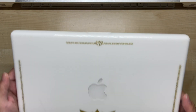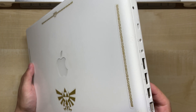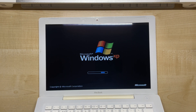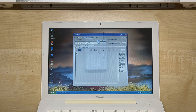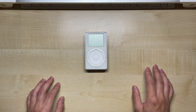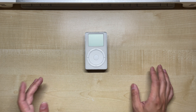Personally, I used this 2007 polycarbonate MacBook. It's got native FireWire 400 support, so no adapters are needed, and I put in SSDs so you can dual boot OS X Snow Leopard and Windows XP for legacy software like Retina or iPod Wizard. Now, if you have a modern Mac and prefer to use that, Finder and the latest versions of macOS still have full iPod support all the way back to the first gen, so you're covered.